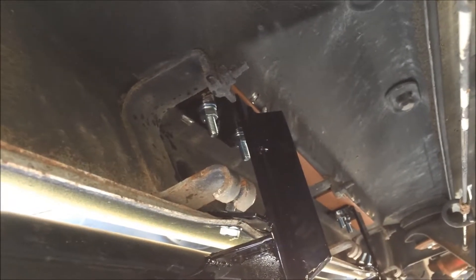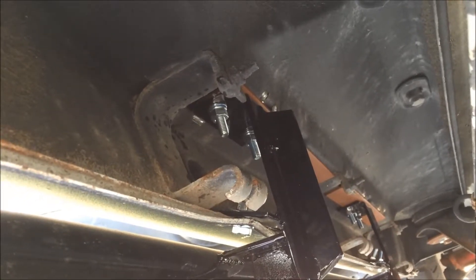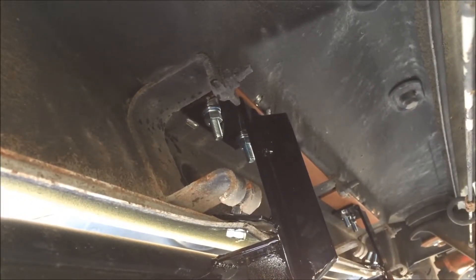You can see I went through the floorboards there at the sill plate — two pieces of grade 8 hardware on each of these mounting brackets, so now there's four pieces of grade 8 hardware on there. Down at the bottom of the sill plate, which ends up deforming the bottom of your rocker, and up there at the sill plate inside the cab — there ain't much wobble on this thing now. I'm going to put two more pieces there so there'll be four in through the sill plate to give it a little more rigidity. I'm just trying to make it last as long as possible.